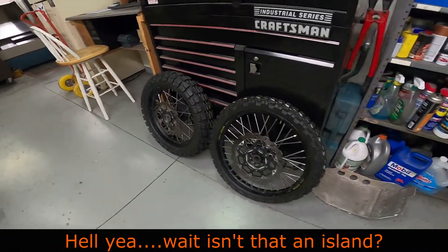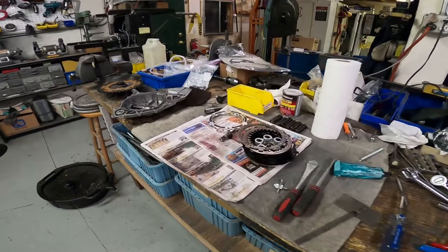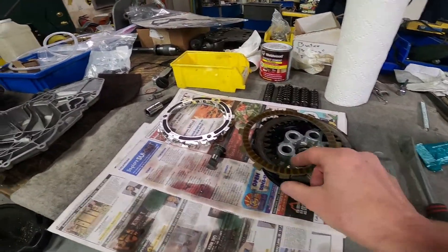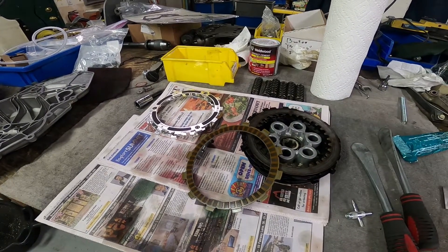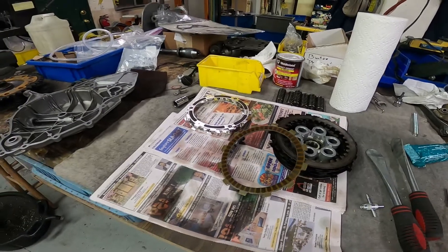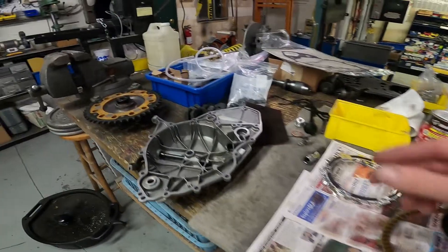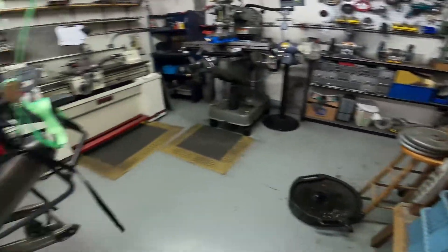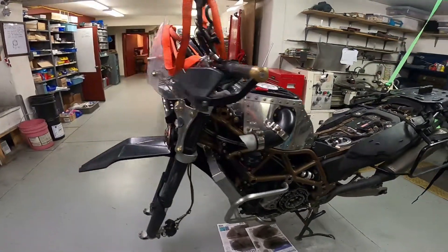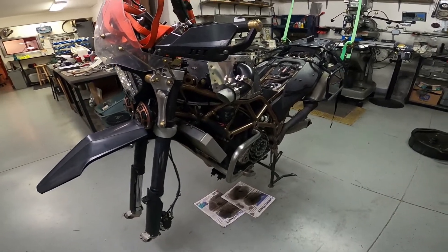He's getting new shoes — Moto Z Rallies, because I planned a rally. We're also rebuilding the Recluse clutch. I took it apart, measured everything, talked to Recluse — it was right on the borderline of wear, so we're replacing all the discs and friction pads. We're also putting in new bushings in the rear hub and removing all the brake fluid to replace it — I think I was getting a little boil-over on my rear brake on the last trip.